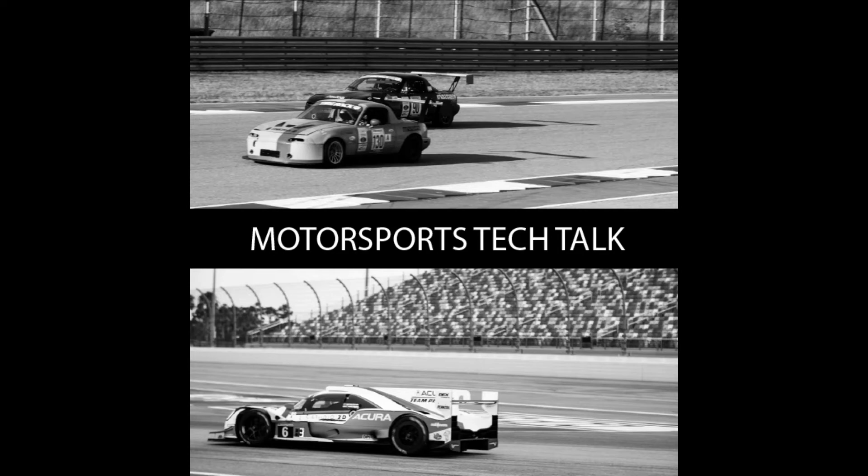The size of the splitter extending from the car is about balancing your front-rear aero. If you have a good wing, you have more scope to change that size. In champ car, where carbon is restricted and you're stuck with fiberglass options, there really aren't that many rear wing options. So building a giant splitter will just result in an unbalanced car.